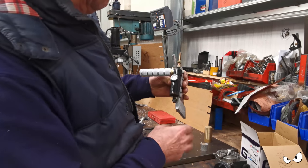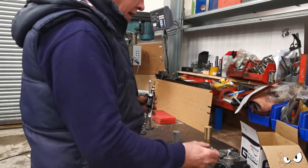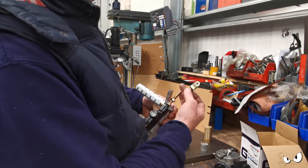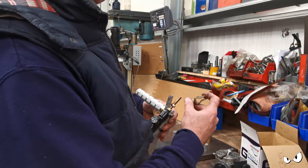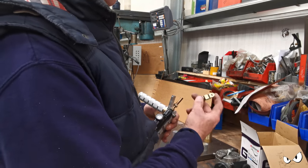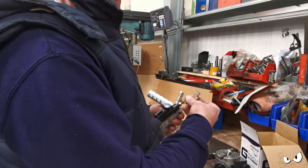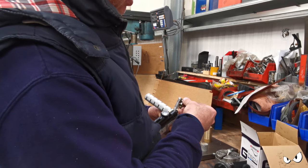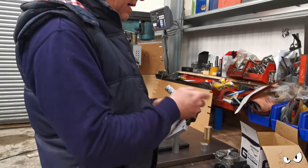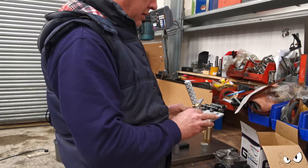If you can see from the top, I've just got this arm here to shape up and this little doohickey thing that screws on the end of there. It would ordinarily have just been linked up here, but that's wrong. I need to remake this. I need to make that lock come up at 90 degrees so I can wind it right down to about there. And we can just have a flat bracket with a hole through it, shove a bolt through it, job's a good one.